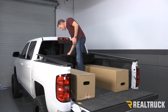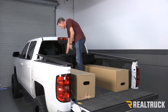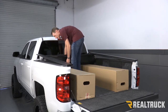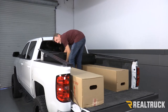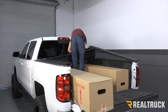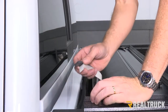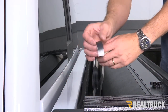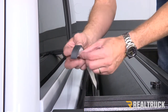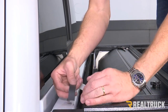Next, we're going to reach inside the canister. We've got a strap inside the canister — we want to push that between the canister and the bulkhead to get it down into the bed of the truck. In this position, we can go ahead and lift up on the canister and slide the boxes out. Next we're going to put on our bulkhead seal, but first we need to wipe down this portion of the bulkhead with alcohol. We're going to be putting this bulkhead seal as far back on the bulkhead, close to the opening of the bed of the truck, as possible.